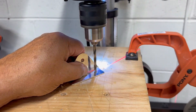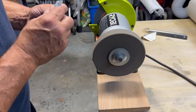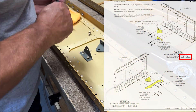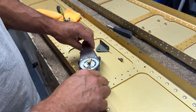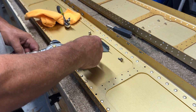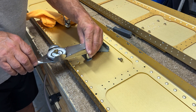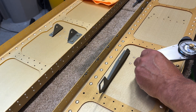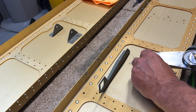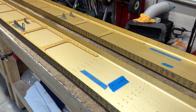The last steps in this section involve final sizing some holes in the parts for the aileron bell crank brackets. These get deburred and prepped for installation. With those parts primed, they're installed on the left and right wing spar as appropriate. Because these need to be torqued down, I looked up the specs and found it takes about 25 inch-pounds, calculated about 10 inch-pounds of drag just from rotating the bolt itself, so ended up around 30 to 35 inch-pounds as I set these into place. And with that, the main wing spars are complete. From here, I move on to attaching the ribs to the spars.